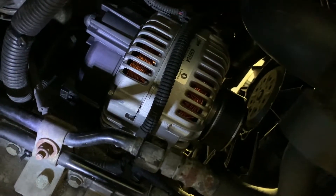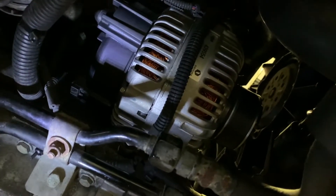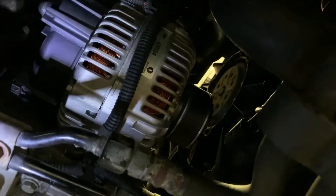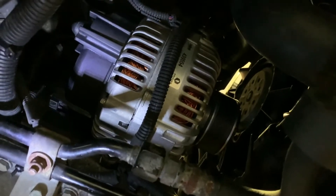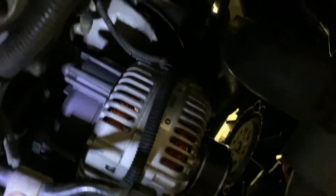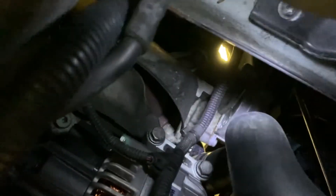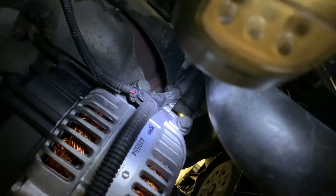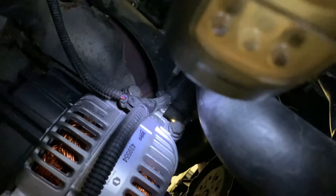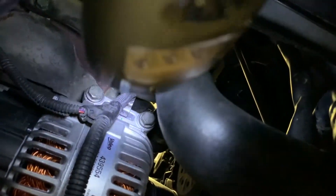This is the view of the alternator from under the car, after it's been safely jacked up or raised. You can see the alternator here — once you have the belt removed, you'll have access to it. There are a couple things you have to do before you pull it out. There's a harness that goes along the side of the alternator with mount points, and between the bolts there's a place where the harness clips into the alternator with a metal clip. Pry that out with your hands or a flat screwdriver. There are two clips total — one between the upper two bolts and one between the lower two bolts — so pull those metal clips out to free the harness.